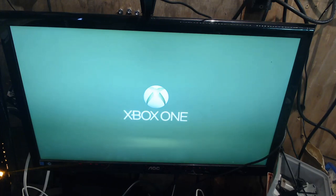I said to the customer, see if she got a screen at all, because when you get a failing hard drive in these, usually you get a black screen. So what we're going to do is pop this console open and take the hard drive out. We're going to test it in the computer, see what it's reading. We're going to try and clone the hard drive onto the computer, and try and preserve the data in this one, because there's a lot of save games on here apparently, and they want the save games saving if possible. So I'm going to try and clone the hard drive using the software we've got on the computer, and if not, then of course we can always just completely wipe it and put a fresh hard drive in there.